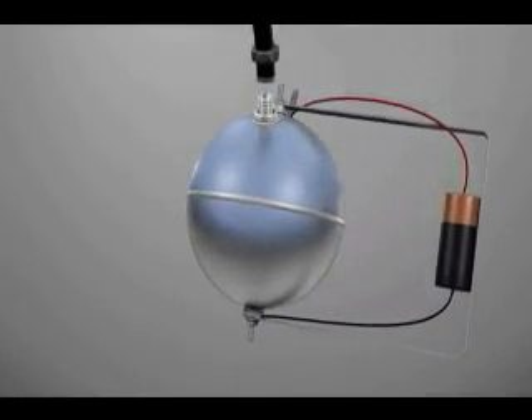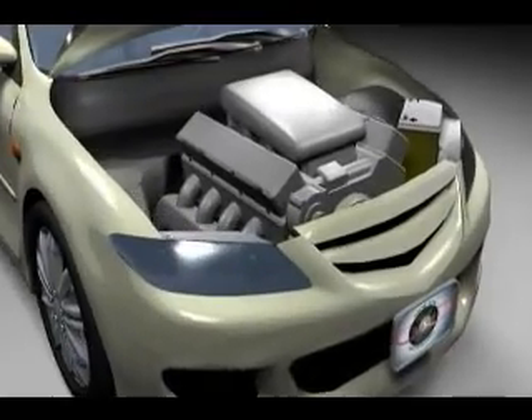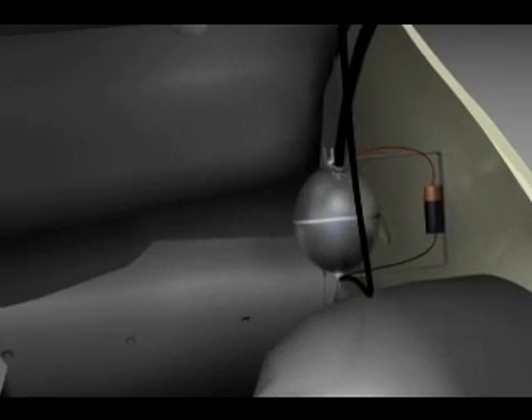Firmly connect the transfer hose and the negative cable. Select your location and install in the engine compartment — sometimes you are forced to find the largest space that will accommodate the cell. Mount with the hose to the top, above the water level.